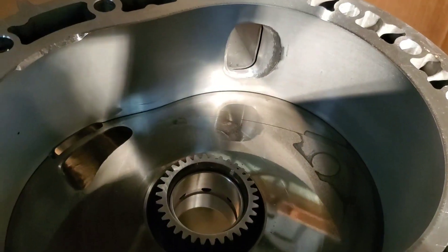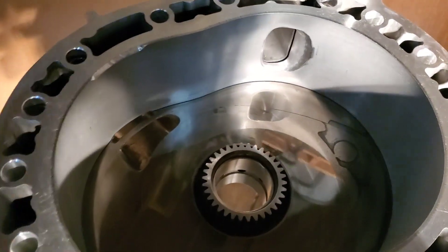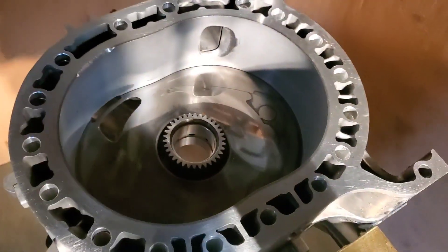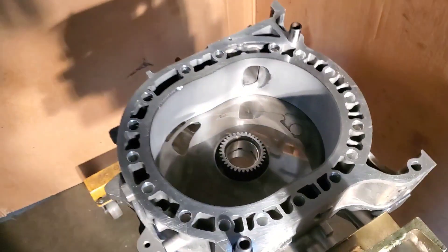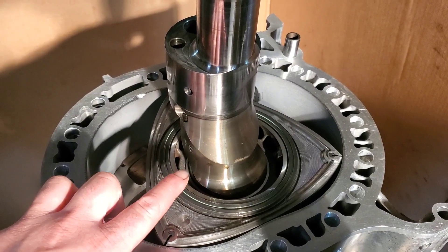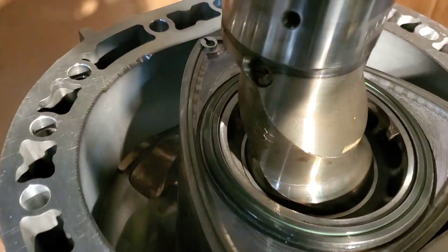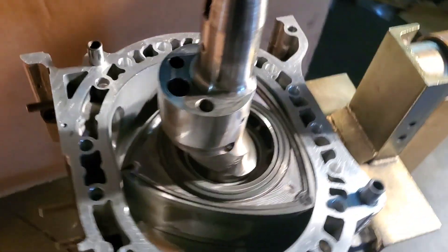You can see they moved the exhaust port timing down, which is what you really want to do on a turbo motor, especially one that's going to have overlap because of the full bridge being on both sides. I probably would have lapped these plates. You can see there's a little bit of water marking there but they're still in great condition. I didn't get to make all the calls on this, so yeah, it's going to be a great motor. We just dropped the eccentric shaft in, rotor in, everything's looking good. Lightened FD3S rotors, new oil control rings, side seals. Side seals are cut to 1.5 thou and you can kind of see what the port looks like down in there. Again, it looks like it's based off the KMR template. I didn't personally do the porting — I'm just assembling it for a friend's shop — but it's looking good. We'll keep working on it.